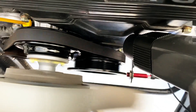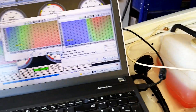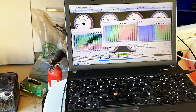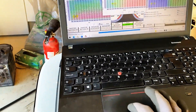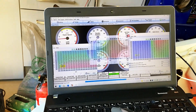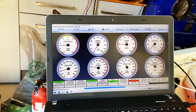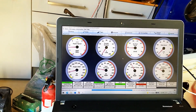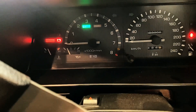I'm doing the timing gun check again, just to make sure it's about 10 degrees before top dead center. At this point it's about 14 degrees, which is also what the tune says. Having that confirmed, it's basically just a matter of letting it go through some heat cycles to get all the gaskets set and sealing properly, making sure there are no coolant leaks, and correcting the tune along the way so I can get a drivable car in the end.